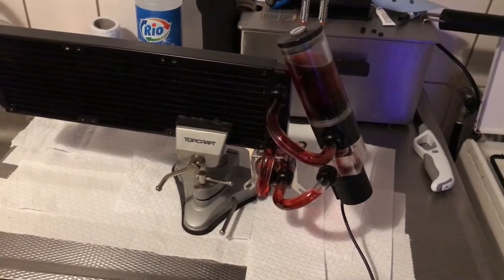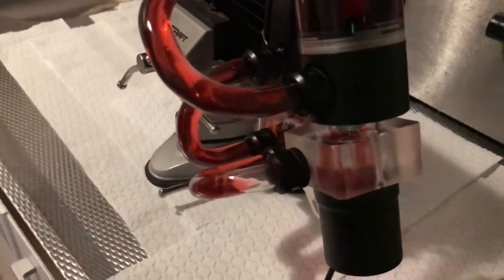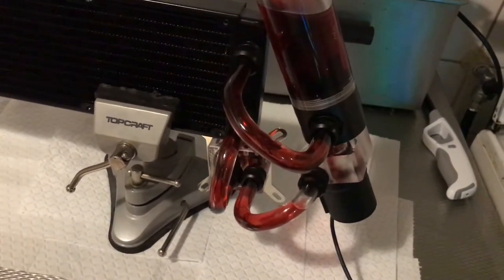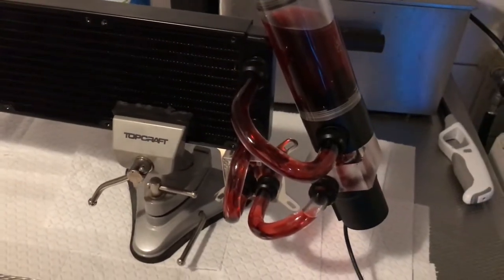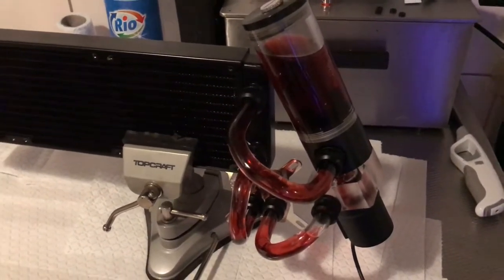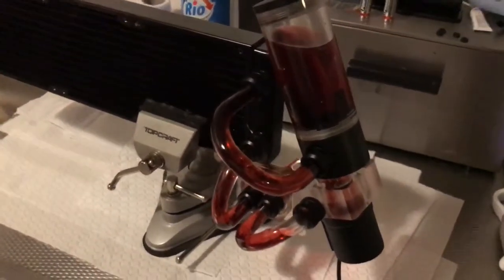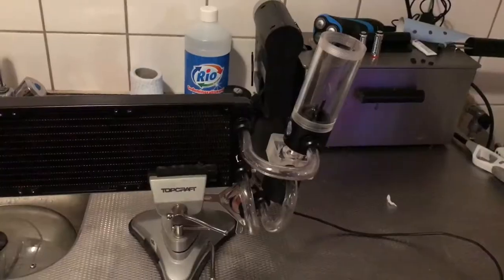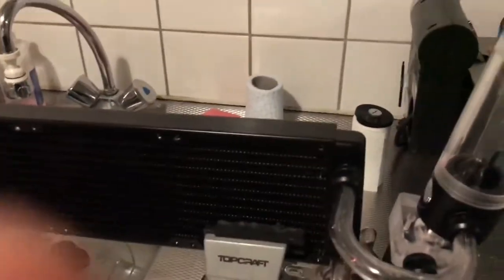It's actually been 2 days — I've been a little ill. Two days later: no leaks, it's been working perfectly. The red actually became much darker, it looks really good. Now I'm gonna flush the system a couple of times. I'm not sure about the composition of the fluid, but I've ordered some temporary fluid. I won't be able to get the Primochill Vue for at least 4 good months because of availability and shipping prices, but I've confirmed the system is fully working.